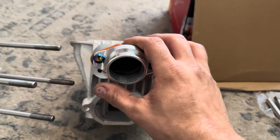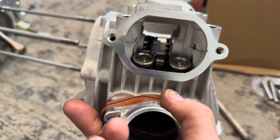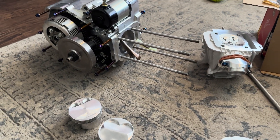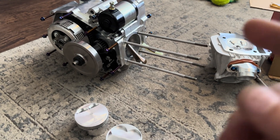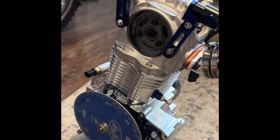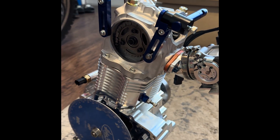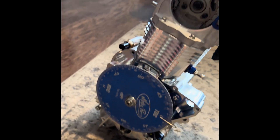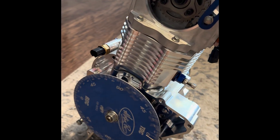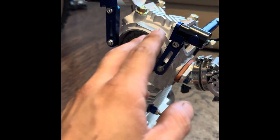It's a really big port - kind of dark in here so you can't see it well - but I put lighter valves and titanium retainers, and a bigger cam, so I should definitely make some power. I put the top end on - piston, cylinder, head - and did the cam timing. This is how I do it. Now I'm basically just going to set the valve lash and put the cam cover on.